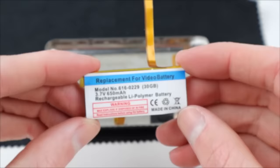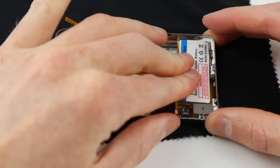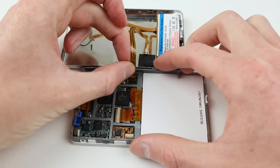The replacement battery I purchased for this I got from eBay — it is 650 milliamp hours. I can remove the backing adhesive and install it into the iPod, pressing it down into place and making sure everything is seated correctly. With that done, I can now reconnect the two halves of the iPod by connecting the one flex cable that goes between the two halves, making sure it's lined up and pressed in enough before I lock it down.